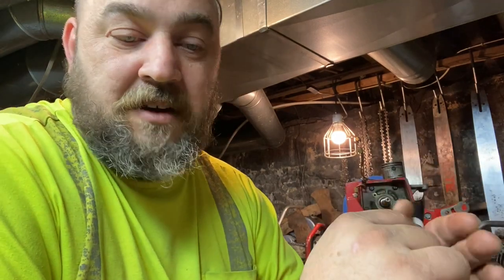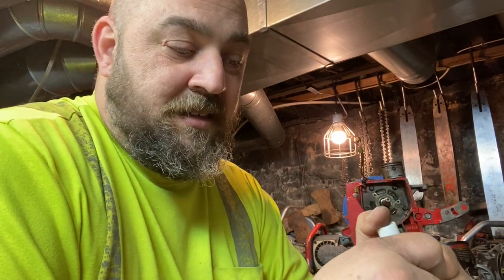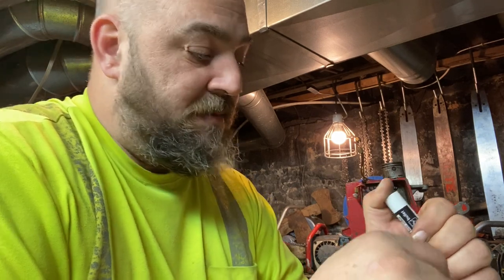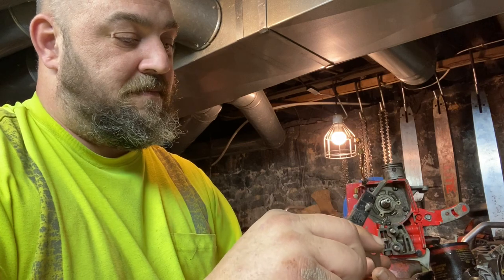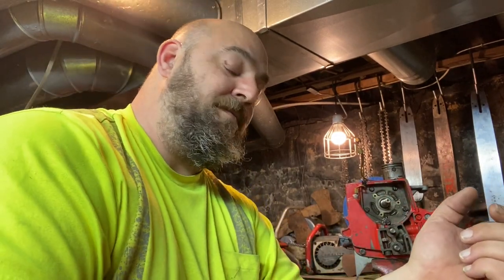So what is 1.3 millimeters? I'm thinking it's roughly 50 thousandths of play that we have. We started off with 87 thousandths of squish, and we are deleting the base gasket. To measure the base gasket thickness — I'm coming up at roughly 30 thousandths of thickness. We'll get into that more. I'll kind of explain the whole reason behind going for smaller squish numbers and we'll dig into that stuff later.